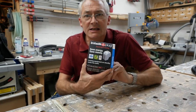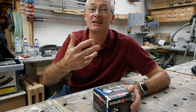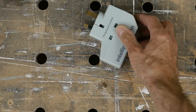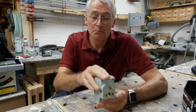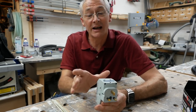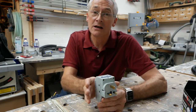The thing I've been using to fire up the vacuum is this — it's called the Intelli Plug. There was a story going around in the media here in Britain about how terrible it is that when you switch off your television or put it into standby it doesn't actually shut down — it just blanks the screen and everything else carries on consuming power. The idea behind this was an energy-saving product. It's a little three-way socket adapter with sensing circuitry built in. You plug this into an outlet, plug the TV into the master socket, and plug your games console and digital recording box into the others. When you cut the power to the master socket, it cuts power to the other two devices as well. And obviously, when you fire up whatever's on the master socket, it powers up the devices plugged into the peripheral sockets.